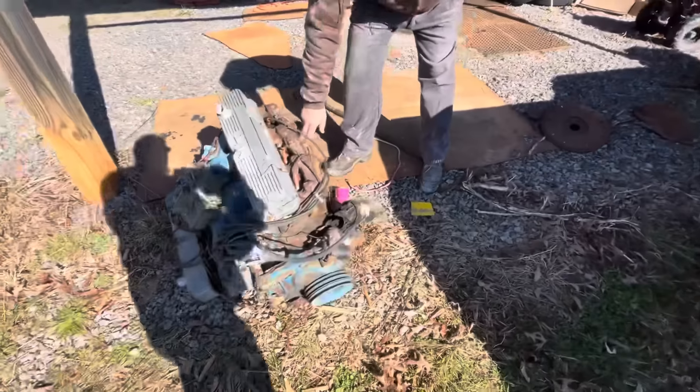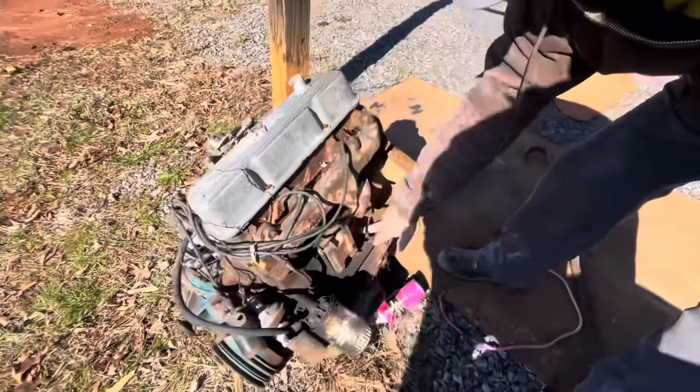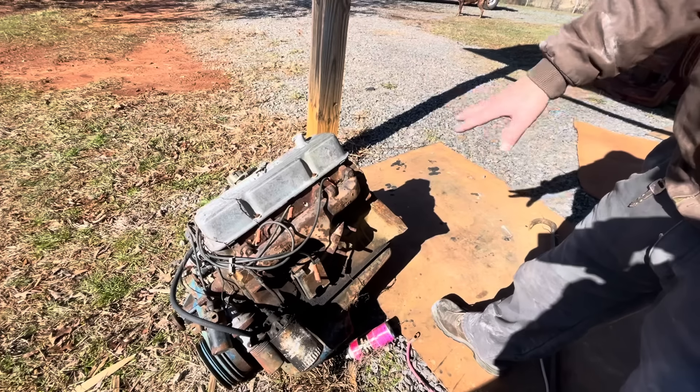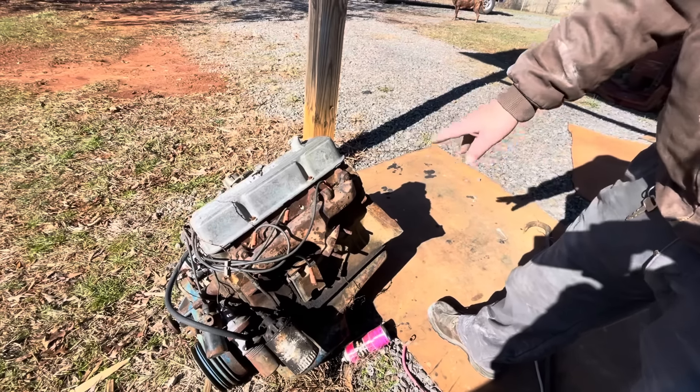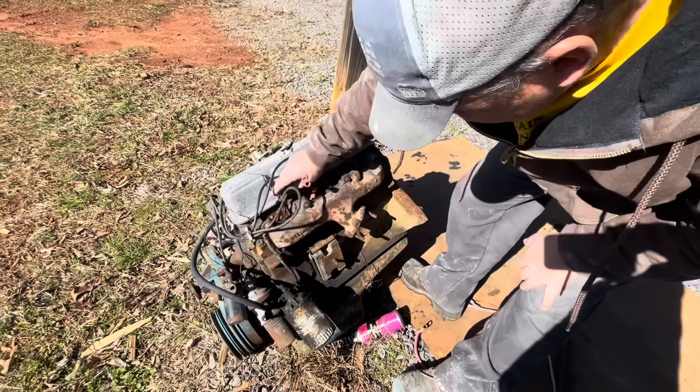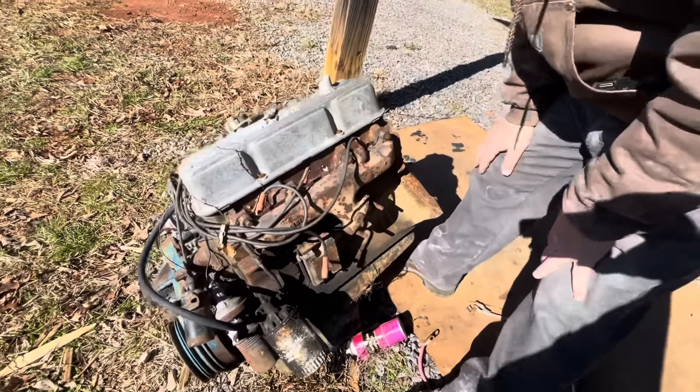It's a later-than-1970 block — it's got the ridges on the outside. When Ford switched over to another casting company after they quit casting internally, they strengthened the molds by putting those ridges in. That is good information. 1972 Ford truck D2TE exhaust manifolds.